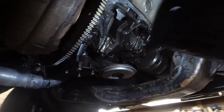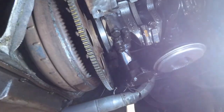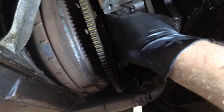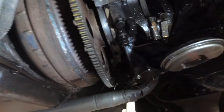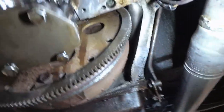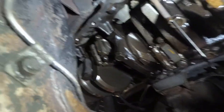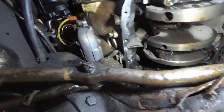There's the gasket surface mostly cleaned off. I've got a few places left to touch up and I'll spray it down with brake cleaner. What's really important is to get all of the gasket material out of the spot where the rear main cap attaches to the block and make sure there's no oil in there. That's why I brought this in last night and drained the oil — so it has a chance to stop dripping. Next is to contact-cement the four-piece gasket into place with a little dab of RTV sealant in each of the four corners.